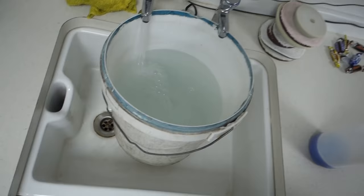They'll come inside to be clay barred, they'll be blown dry, and they will go up on the ramp ready for some polishing. The A5 is, as I say, a two-stage minor correction to lift surface defects, light scratches, and buffer trails, which there are lots of. You will see this later on. And the A4 will be a single-stage enhancement with localized corrections where required. Both vehicles will leave wearing the best possible exterior protection and will receive interior work as necessary. Onwards outside for the wash, and time to get cold.